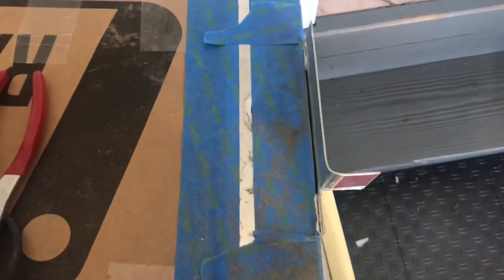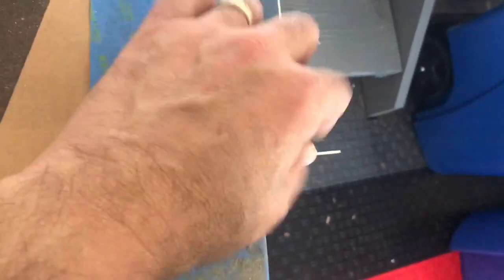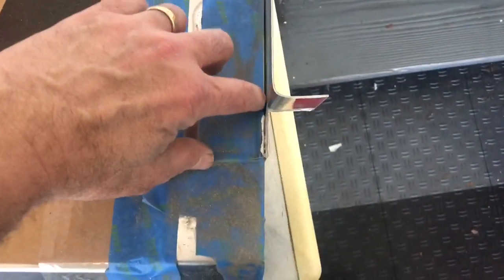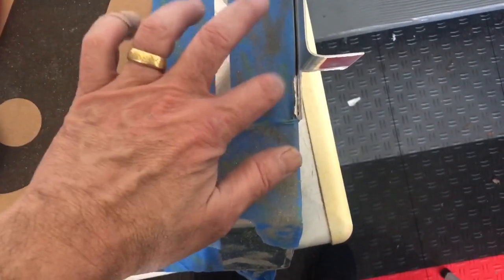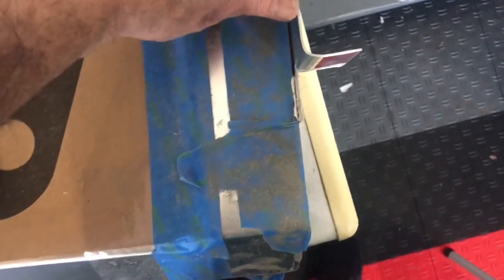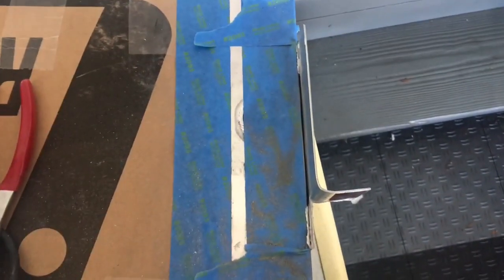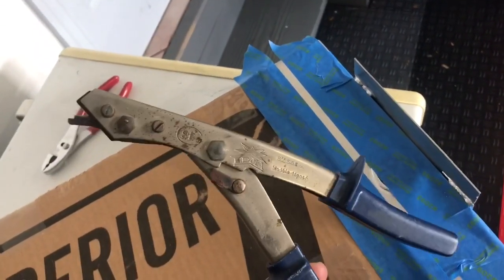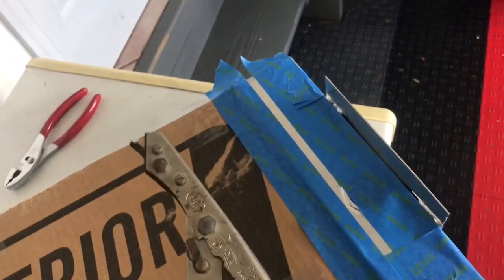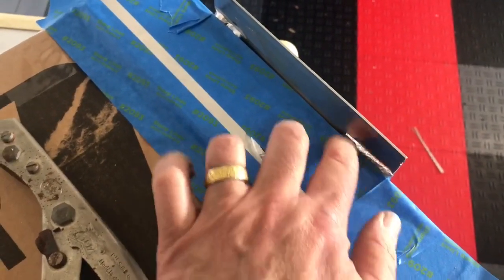Here's a little work in process. Basically, I cut a slit right above the weld on both sides, bent the tab back, and then ground with the Dremel wheel right along the weld, being careful not to puncture or intrude on the body of the radiator. I got a clean break. This side came out good. I went down to the basement and found this old tool — it's actually made in France, my dad's tin snips — and it just cut this away really nicely. Now I'll bend this out and grind it down with the Dremel. This is speeding things up.